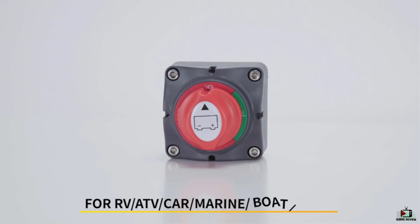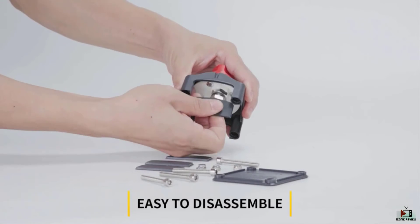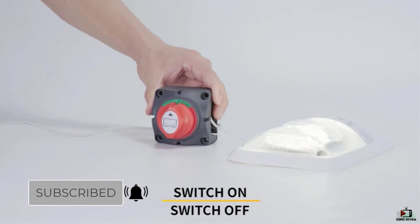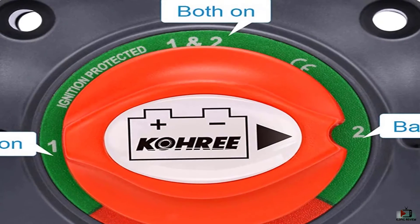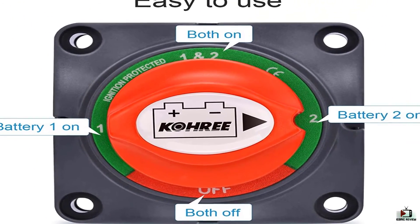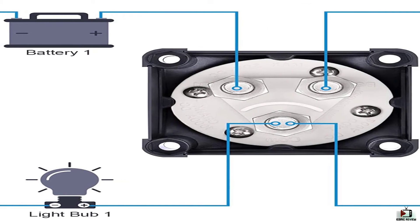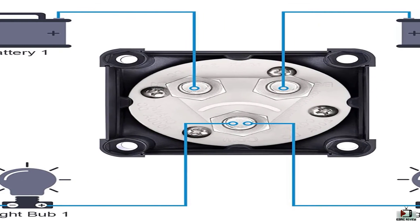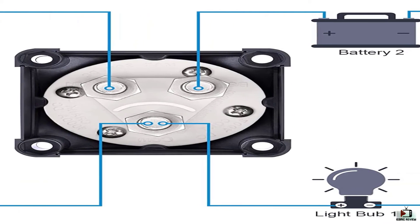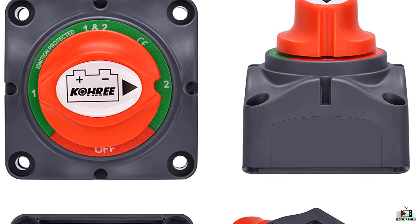This system can be used with both cars and boats for providing that all-important backup. Thanks to the 12V-48V DC 200A charging relay, batteries automatically combine during charging. It will also automatically isolate the batteries during engine cranking and when there is no charging. With a 1-2-both-off battery selector switch designed for two batteries, it can switch battery one or two separately, or both on and off. Because of this technology, the charge between two batteries can be shared more efficiently than standard isolators.